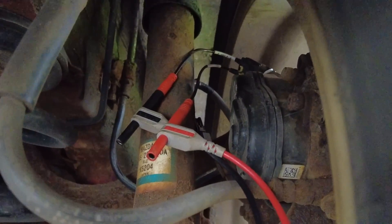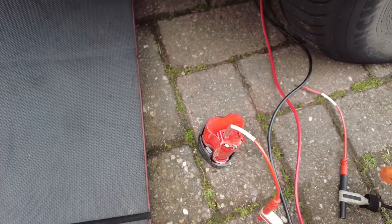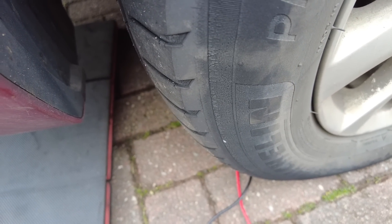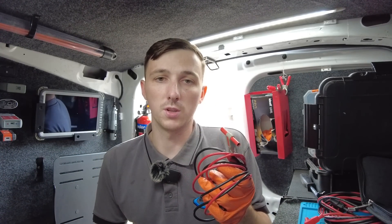You can see our connections are now made directly up at the caliper itself. This isn't a how-to — this is just the way I'm testing it. I'll move the mic closer and hopefully we'll hear the actuator on the caliper move. If you saw that on the video, hopefully it captured it — that basically means we've got a good caliper, but somewhere along the wiring from that plug to the actual caliper there's an open circuit.